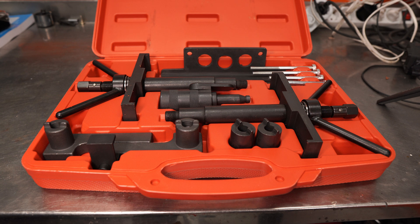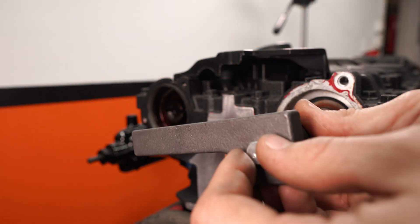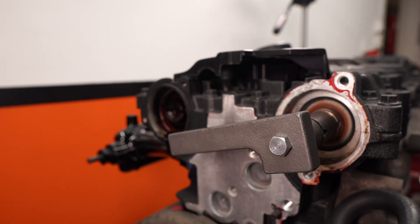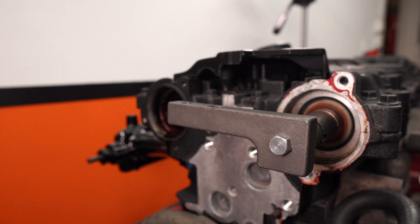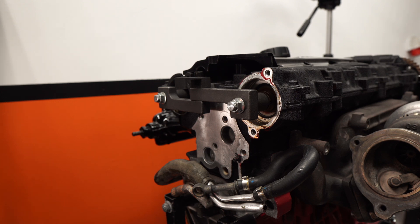We're going to use this to lock our crankshaft and camshaft. Let's install the exhaust cam portion of this special tool. Carefully turn the exhaust camshaft clockwise with the camshaft adjustment tool until the intake camshaft tool can be applied, then screw the camshaft adjustment tools together as illustrated. So that is the cam locking tool in place - was a bit of a struggle. Really low quality stuff, not really going to recommend this, but I'll still link it in the description. Hiring the original Volvo tool would make you a lot happier because this was really low quality.